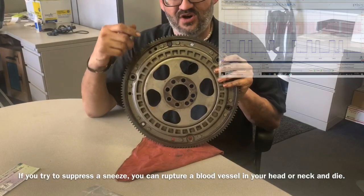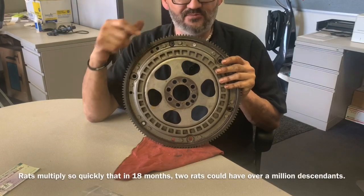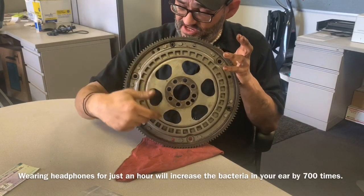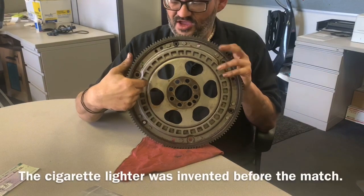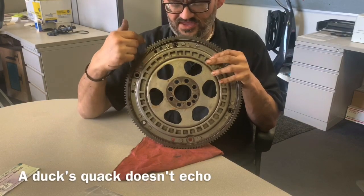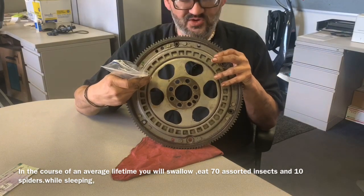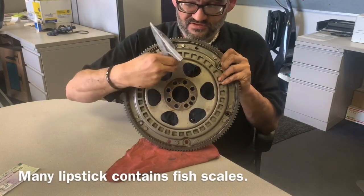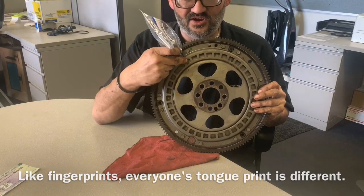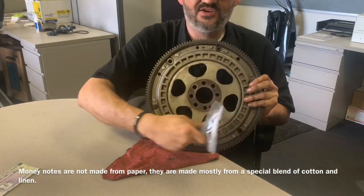Okay, keeping with the show theme of not only repairing a problem, but kind of giving you a layman disclaimer on what's going on, we're going to talk about crank sensors today and how they actually communicate with the ECM. What they do is a crank sensor will be bolted in a position that it can see this wheel right here. Now this wheel is on the flywheel, it's going to be on the back of the motor in this particular situation, but there's going to be a sensor there that's a Hall effect magnetic sensor, and what it's going to do as the engine spins, it's going to get these little signals from these small boxes, and then when it gets over to this big box right here, it's going to go, hey, I'm at number 1, top dead center, and it's going to tell the computer that it's at number 1, which will restart the computer reading this process.